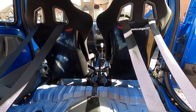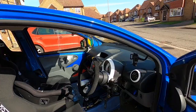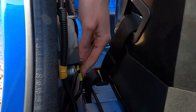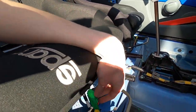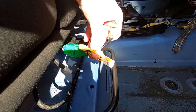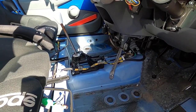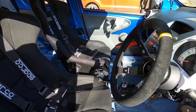For a quick resistor overview: for the steering wheel it's simply two wires — just put the resistor into those two wires and that job's done. For the seat you want to put a resistor in or just put the standard connection back on the seatbelt tensioner, otherwise that'll throw up warnings. Finally, get the orange and yellow wire and connect the resistors to those. The green and yellow wire doesn't do anything, so don't worry about that. After that, just get the faults cleared and everything should be good to go — the light will come on the dash normally and then go off.